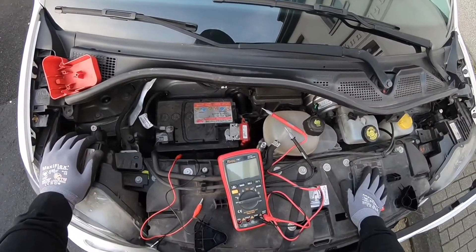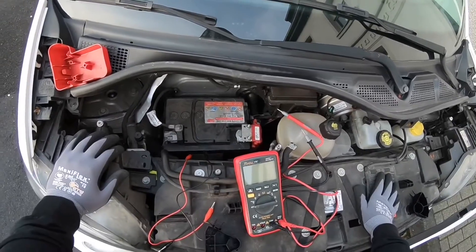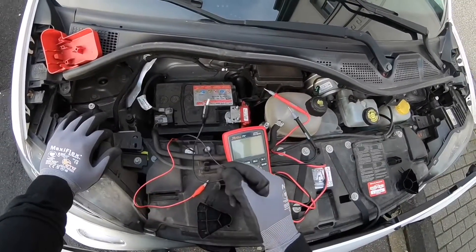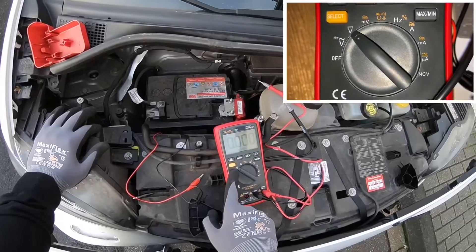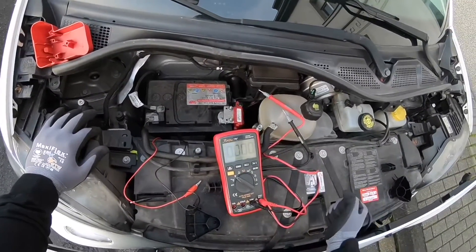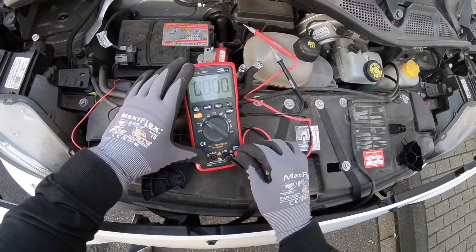Let's perform a DC voltage measurement. In this case we are going to use this start battery which is inside a Smart Fortwo. This car has some problems starting up in winter time. First thing is relative function selection — switch to the V, and above the V there are three dots and one line, which is for DC voltage measurement. In this car a battery is installed.